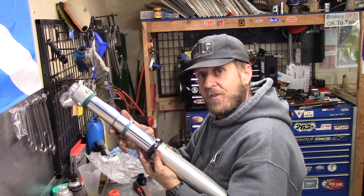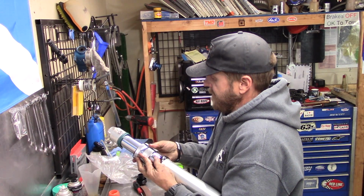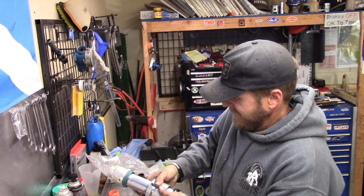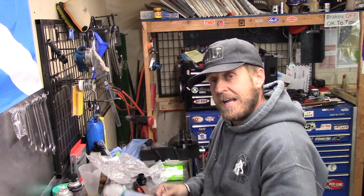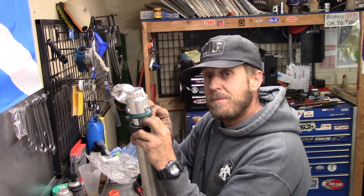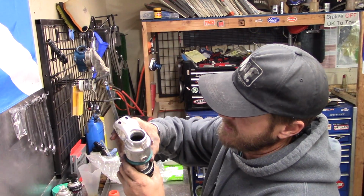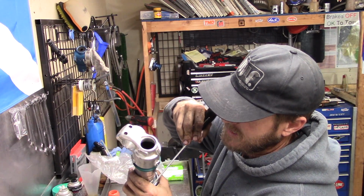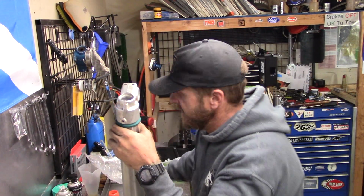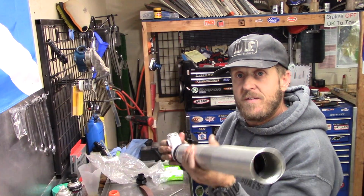Now we're going to take the oil seal, slide it down, get our driver on there, and then listen to this. You can hear it too. So that's it going home. Good. Now we're going to take the snap ring and we're going to put it in there. And you want to be careful because you might have to use a flat blade screwdriver to kind of tuck it in there, but you want to be really careful that you don't damage the seal. So we got it down in there a little ways. We're going to come in here and just go nice and easy. Keep that in there and get it down into its home. There we go. And then with the dust seal, I just push like this and push it down. We're good to go. Everything moves smooth.